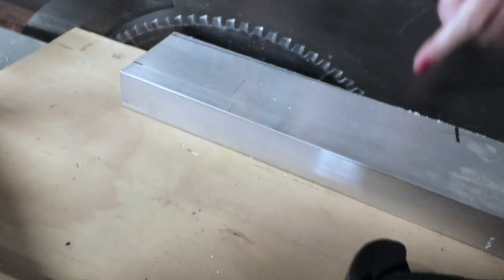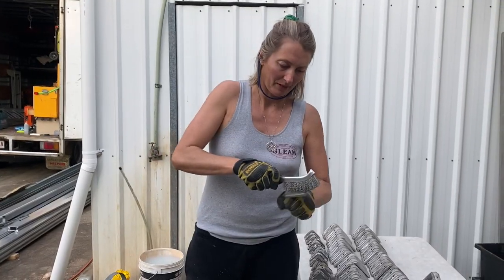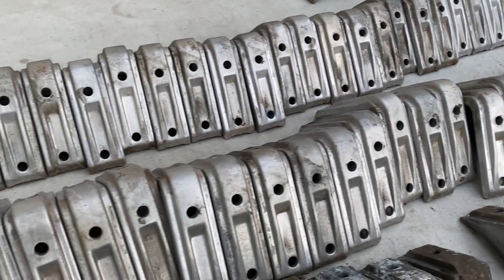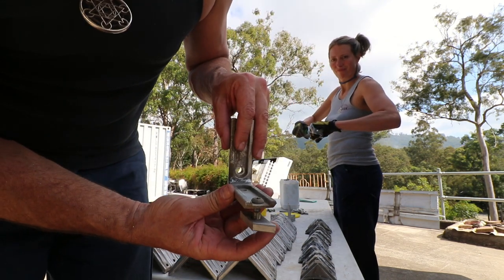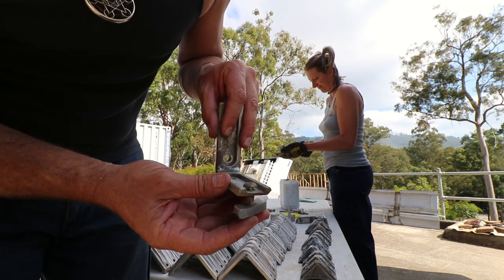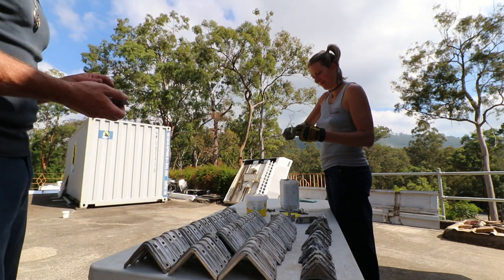Look at the size of that - it just builds up aluminium. I'm here brushing away with the wire brush this afternoon. These brackets are corroded - a lot of corrosion on them - so I'm just scrubbing them. There are so many of them. I've spent hours doing it today. It feels really nice that every single little part of this bus has been touched by us and given love. When they go in, they drop into the extrusion like that, then you put tension on the bolt screw and it turns around and locks in. You tighten it up and it secures very quickly and easily - no welding required.